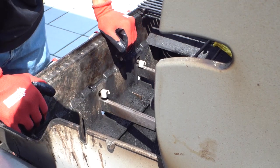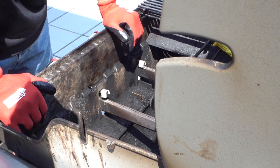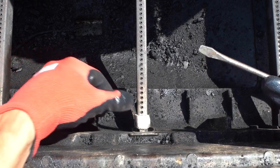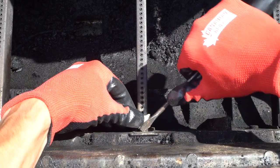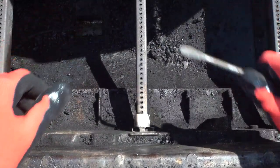Now, we need to correct this issue and place our electrodes back into the proper spot. When completed, each electrode should be firmly in place, with this bump on the side of the body secured tightly inside the metal clamps. All we're going to do here is carefully hold down and position the head of the electrode with one hand, and then use our flathead screwdriver here to apply an adequate amount of pressure to click the body back into place. Once finished, you will see how the electrode is now securely fastened and the circuit is once again completed.